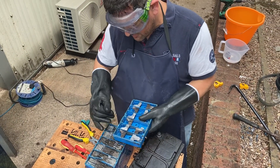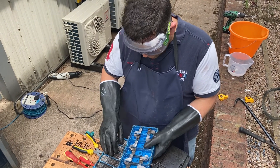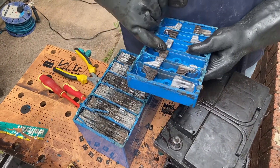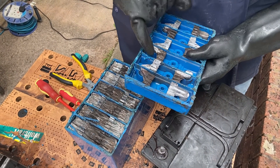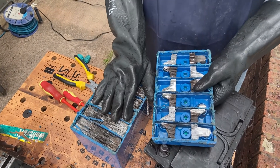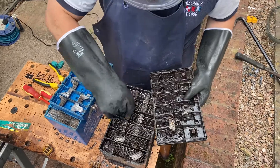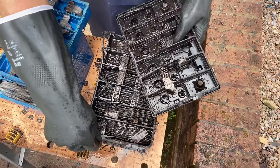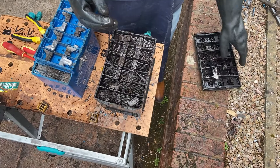One of the things we notice straight away with the Full River battery is that the interconnecting bus bars go over the cell partitions — they actually interlock with the tops of each partition and are then sealed with epoxy, making it a very strong structure that stops those cells moving about. On the standard battery, there's no such thing — the connectors are just clipped on top, and you can see the cells moving around straight away. The flexibility of the case causes problems as it's that flexing which causes batteries to shed their active material.